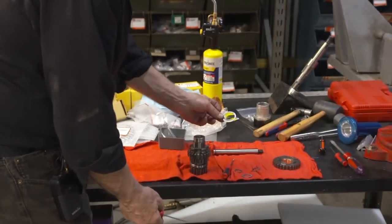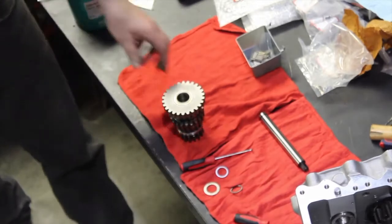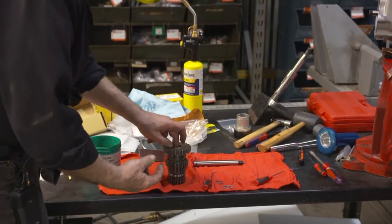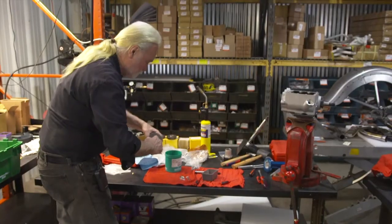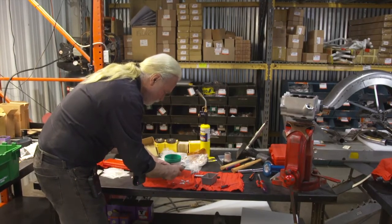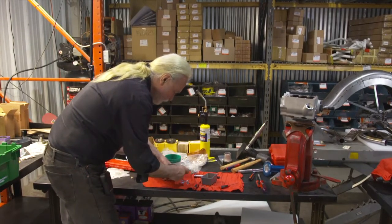Now I've got our end gear, our thrust washer with the proper holes. I'll just put her down into position and I'll slide our gear on as such. Now we're ready to grease this. We first install our proper inner thrust washer, flush against the inside retaining ring. I keep kind of feeding some grease to this because we've got to kind of hold these into position as we move forward. Making sure the backside is stacked against the thrust washer, the inner thrust washer.